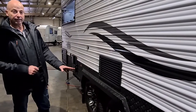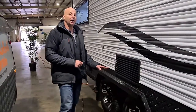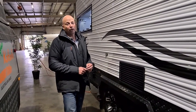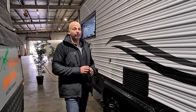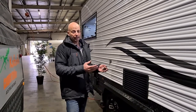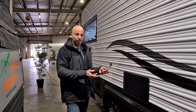Tyres and wheels — these are our standard 15-inch tyres and wheels. They're light truck tyres so they can go up to 80 psi. However, for normal use, I would run them at between 50 and 55 psi. If you start getting onto corrugation, it's a good idea to let the tyre pressure down — you'd need a compressor with you — but I'd probably take them down to about 35 to 40 psi so that they are absorbing some of the corrugation and the bumps.